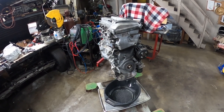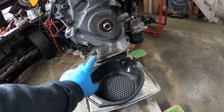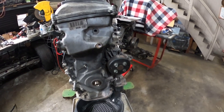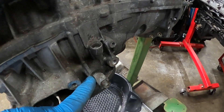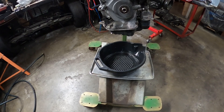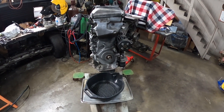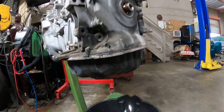I'm gonna start by draining the oil — I already drained most of it but I'm pretty sure there's some left — and I'm also gonna remove the oil filter. I did drain the antifreeze; there's a drain plug right here so there might be a little bit more. I'm gonna grab some cardboard and put it underneath. Once I drain my fluids, I think I'm gonna start with the oil pan, then remove the valve cover and the front cover.